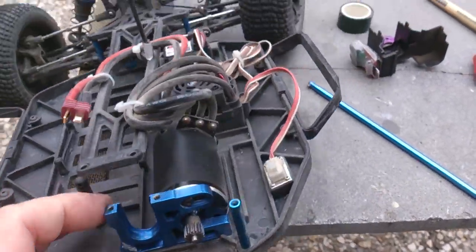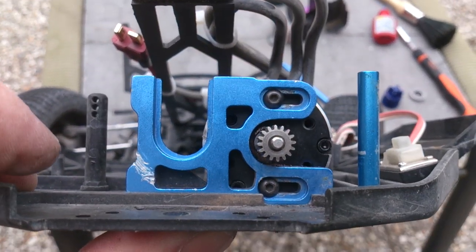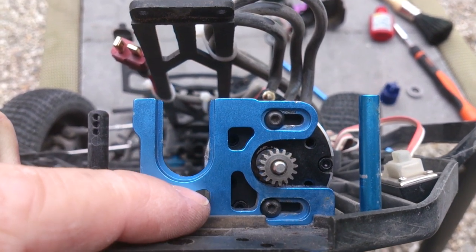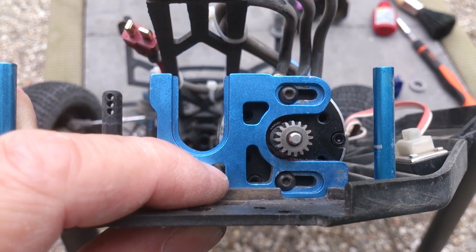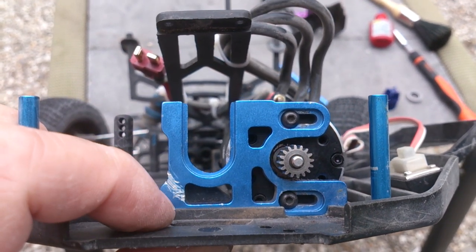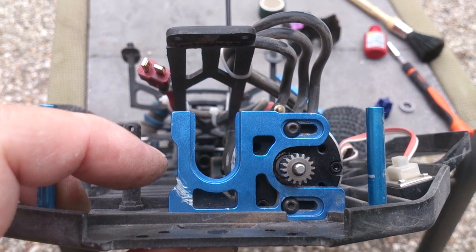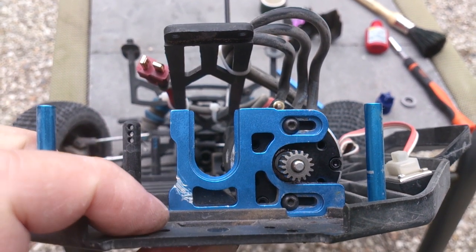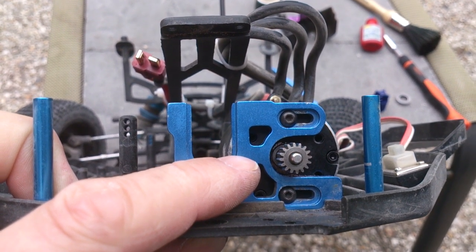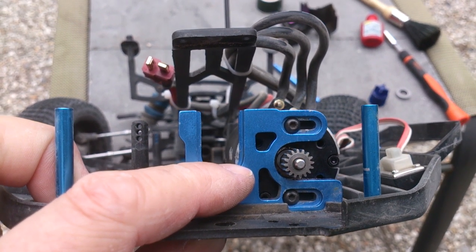You can actually look through a hole here — this was actually a piece of the chassis, but because the motor needs to move in so much, I had to remove part of the chassis. That doesn't strike me as a very good design. They also offer a 77-tooth spur gear, so get that as an upgrade as soon as you can. With a larger spur gear you can run a somewhat larger pinion, which means you can move the motor a little bit out and have the clearance you need.